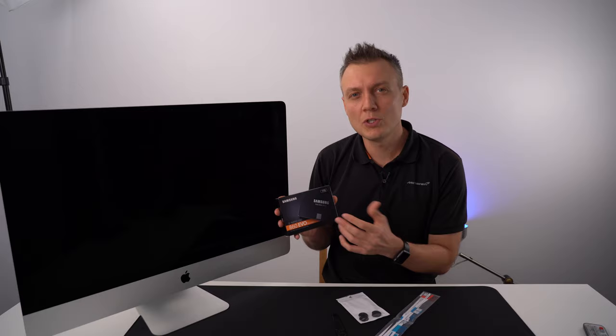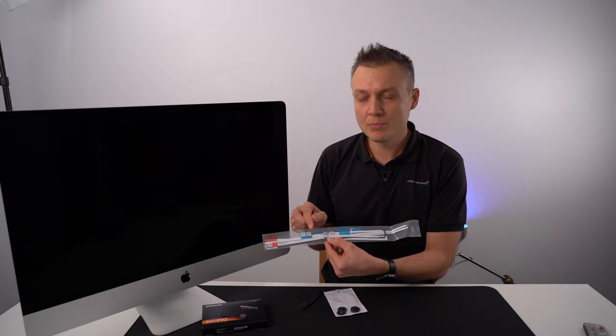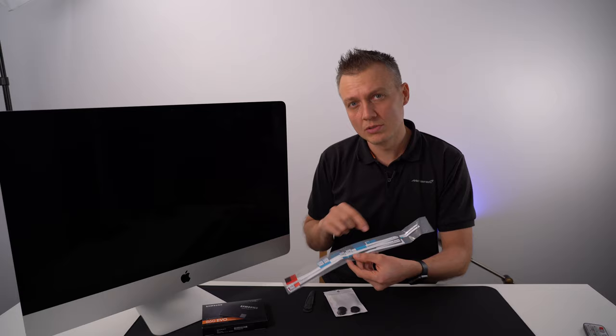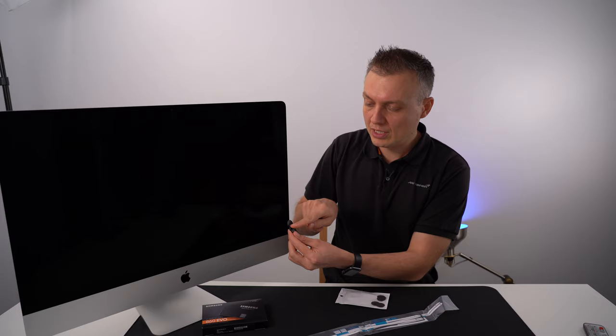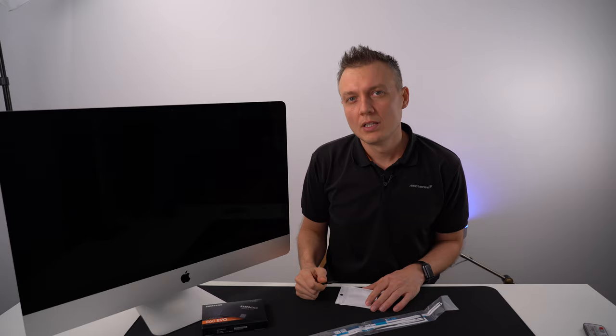Cool. So I ordered and I finally received my toolkit. These are the adhesive strips. Once the screen comes off, I'll have to use them to retape the screen back together, because there's no screws, it's only a piece of adhesive. And this is the cutter. It has a specific length that it goes to, so as not to cut, let's say, the camera in here, because hopefully you can see that. It only goes about 7 mm, maybe a bit more. So let's get to it.